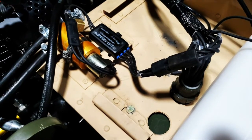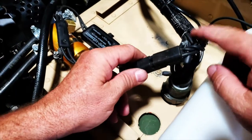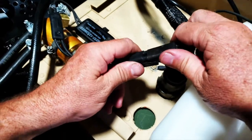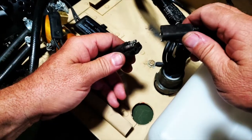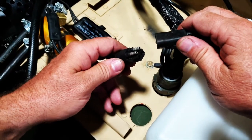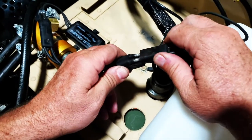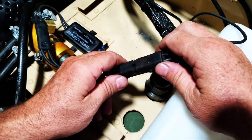One of the first things we do to test the cooling system is unplug the time delay module from the engine harness. It's the four-pin plug — you simply pull the two apart. When you pull that apart you should see the fan clutch engage, and when you put them back together you'll see the fan clutch disengage. It's going to move just a tiny little bit forward or backwards.